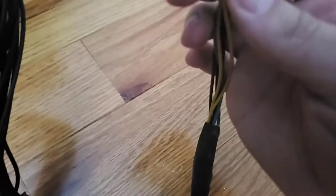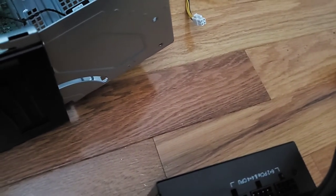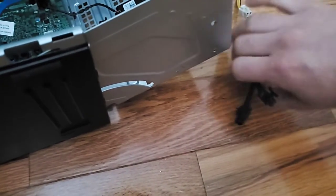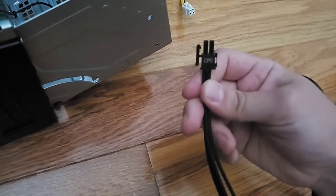That's snapped in. So we're converting from a 24-pin down to the 8-pin we need, which will go right here on the motherboard. Now for the CPU power: the Corsair cables are labeled, which is helpful. This one is Type 4 — on one side it's split so you can use either 4-pin or 8-pin combined. We just need the 4-pin, and the side labeled 'CPU' goes to the motherboard.